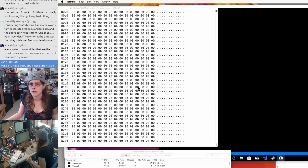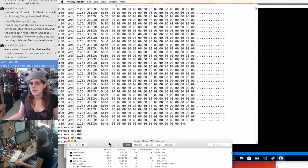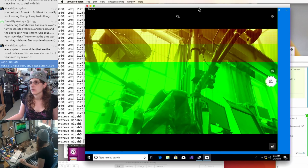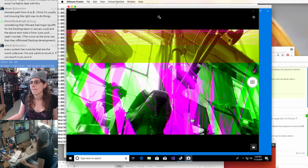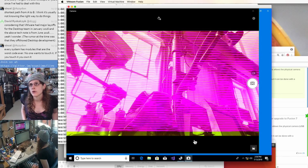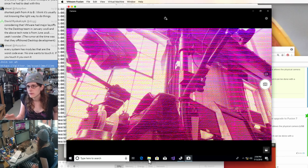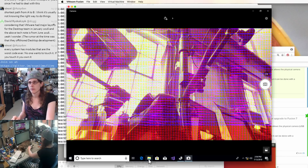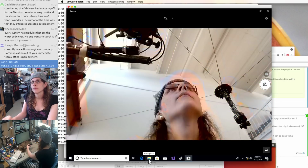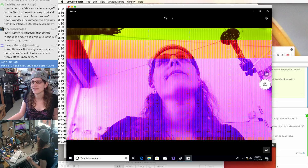All right, yeah, let's make that change. I don't think I'm gonna get anywhere with the full logs here. This is a case where hardware, oh, am I gonna save enough CPU just by not tailing the log? I think what we're seeing is that some individual isochronous packets are dropping, and so we're seeing the driver doing a kind of bad job at recovering from those packet losses. Yeah, let's have just packet headers, as nice as the glitch art is here.